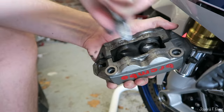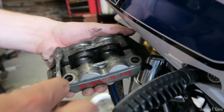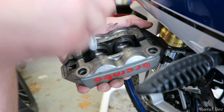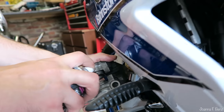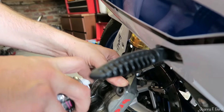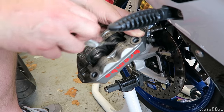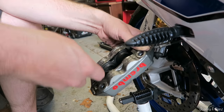Give it a good old toothbrushing. Try and get around the back of them. It's basically just like cleaning your teeth, with this brake cleaner. Very important: don't use anything greasy. Brake cleaner evaporates super quickly. You'll be able to see all the dripping mank coming out. You can spend hours on this, but if you do it regularly, you don't have to do it too much.